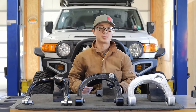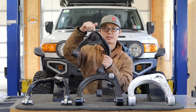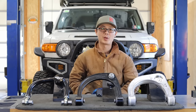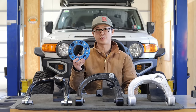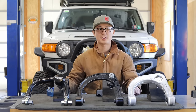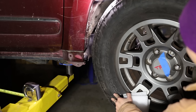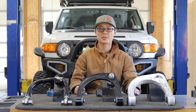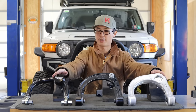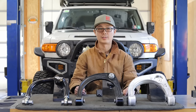In addition to the body mount, wider tires like the 285s can interfere with the factory UCA, because the factory stamped design has a lot of bulk in front of the ball joint. This forces one to run more negative offset wheels or add a wheel spacer. Wheel offset has a significant impact on body mount clearance — I measured that with a 1.25-inch wheel spacer, we lose over half an inch of body mount clearance, which easily cancels out the maximum clearance gained from alignment. Most aftermarket UCAs have more clearance around the ball joint, which is nice to have for even wider tires like 305s or 315s. However, some aftermarket UCAs have similar or even worse bulk than factory, so if you don't like running too much wheel offset, make sure you do your research.